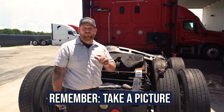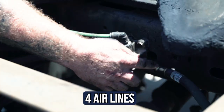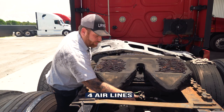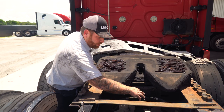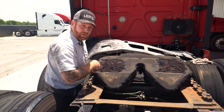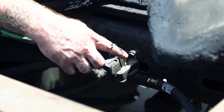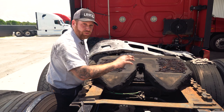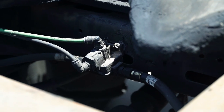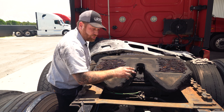On this truck that I'm working on, this quick release valve has four airlines. We have a rubber one on the left and one on the right, and then you have a green one on the top and the black one in the front. The one on top will go from here to the ABS valve, and then the other one from the front will come down inside the frame on the driver's side of the truck. The rubber lines go from the side to your brake chamber on the parking brake side. When you push in the valve, it receives the signal to release the brakes.